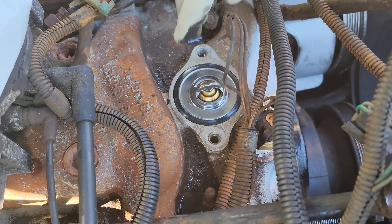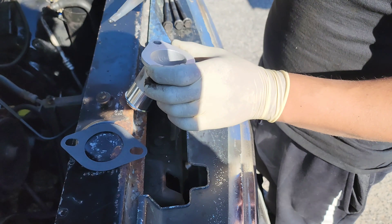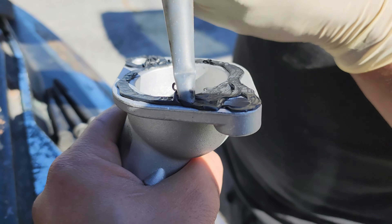This is the air gasket. We got the gasket around the thermostat — that's how it looks, drops right in. Try to clock it the same way it came out. We're going to put the new water temp sensor in and then put the new thermostat housing on top.